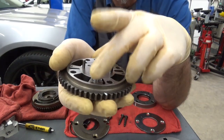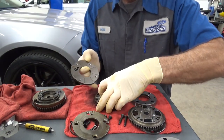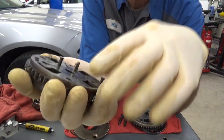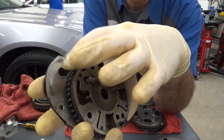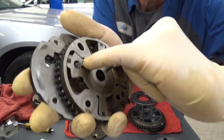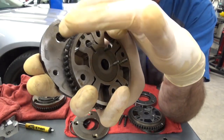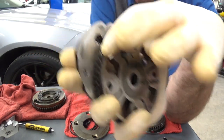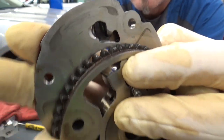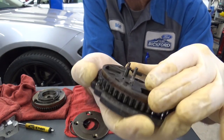I hope this answers some questions on these. I still think when I pulled this thing apart, this entire phaser assembly is completely full of oil — every port in here is full of oil. For that pin to go in there and fully seat, oil has got to come back out or it will hydro-lock it, and it looks like it comes out right through the slot here. I suspect they are not fully seating and then eventually they are wearing the edge of that round slot and it is not really even round anymore. So there you go guys, I hope this answers some questions. Thanks for watching and we will see you in the next video.